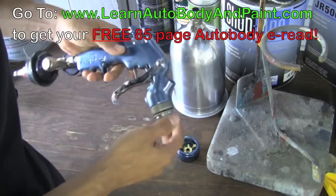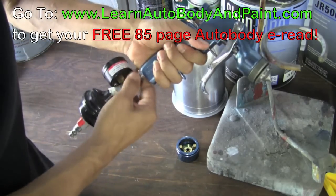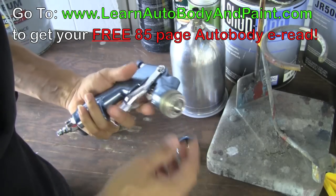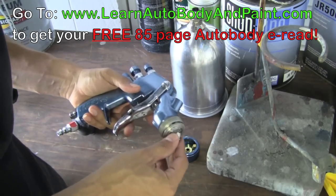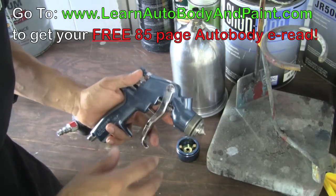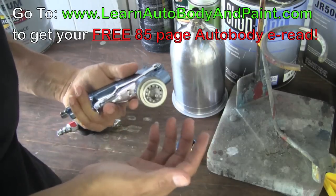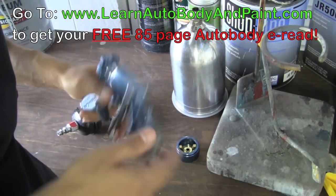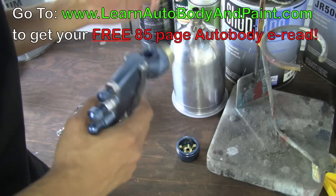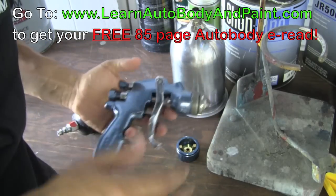You can also pull these apart, take everything apart, pull the bottom off. Just soak it, get a brush — a toothbrush if you don't have a cleaning kit. Clean the gun after each use. It's very important because once you start getting clear coat or paint caking up inside, you're going to have problems spraying — it'll come out uneven, and you'll have to stop and disassemble the gun, delaying your whole painting job.